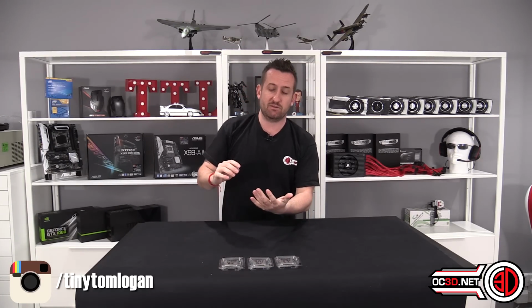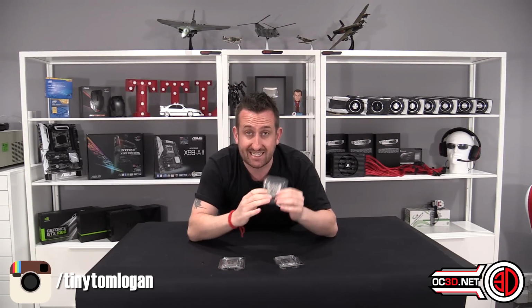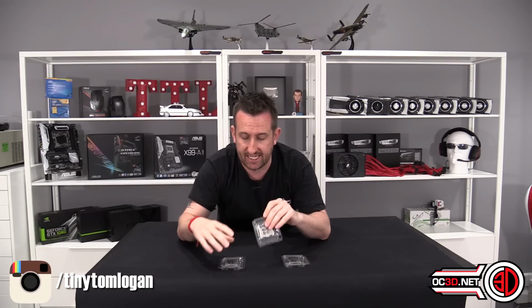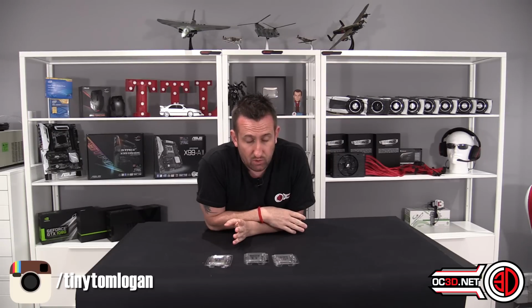And that goes across the range as well, because this is something that I was quite impressed with. It doesn't matter, because I've tested, as you've probably seen in the graph at the top, the 6850K, the 6900K, and the 6950X. I've done all three. I was mental. I stayed up late. So with the three processors, every single one of them ran quite comfortably at 4 gigahertz. And with the BIOS, like I said, it made all of those cores run at 4 gigahertz, not just a single one. Maybe some clever BIOS munching going on in there, but I think all of the big brands will end up doing that, because if they don't, then one of the boards will look like it's performing an awful lot worse than the others.